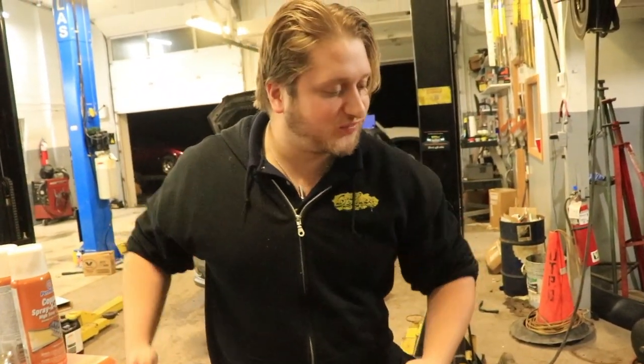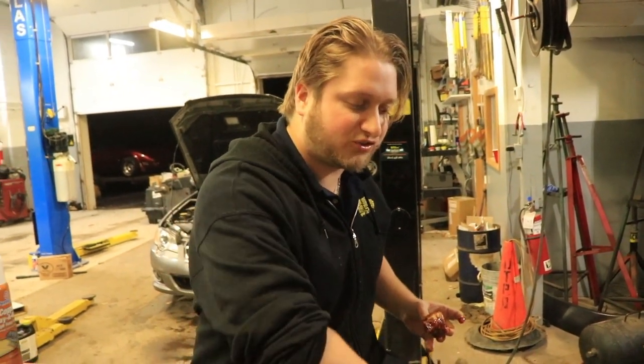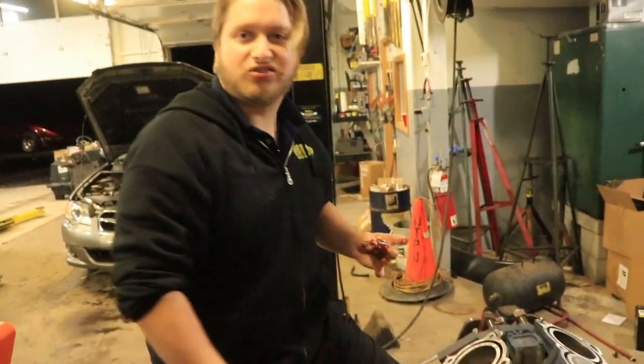All right, so in this video, we're going to teach you how to jerry-rig a fix if you don't want to resurface your block or your heads. There's a couple ways we can accomplish this. The one scenario that we saw online, which was probably the best way to do it, is they dig out those pitted areas and then put JB Weld over the surface and then take a straight edge and scrape it backwards to make it smooth on both the head and the block, so that it's basically recreating the mating surface.